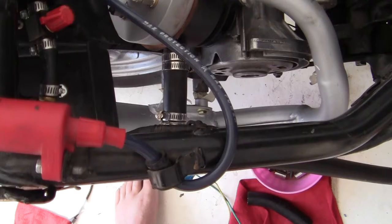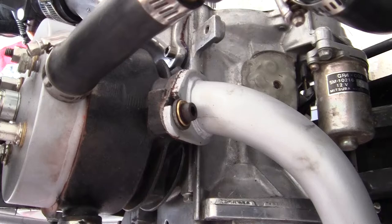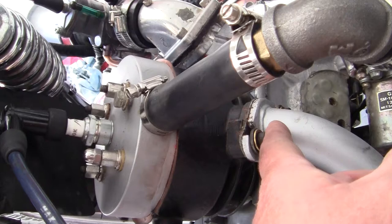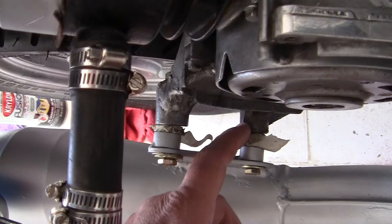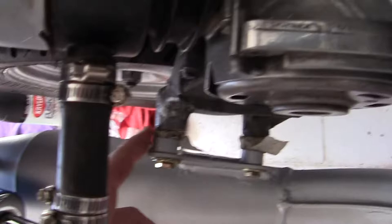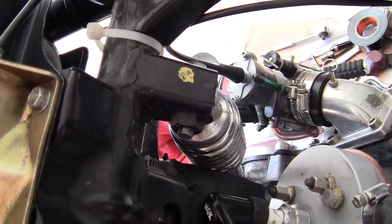As you can see I fixed all that and hopefully it'll stay fixed. Another thing I did with the pipe — this is a very good tip of the day on pipes: if you get an aftermarket pipe that fits your cylinder perfectly, take it off and check it because none of them fit perfect. I made sure that the free flow of exhaust from the cylinder head into the pipe was as straight as I could get it. Then I put five or six little tiny washers with tape right here as a spacer, and a couple of washers on the top. That gives me less stress on the pipe and a freer flow on the exhaust.